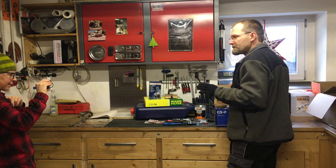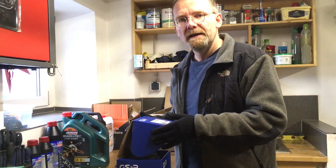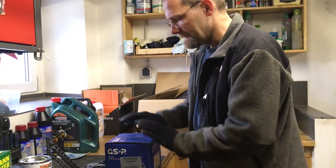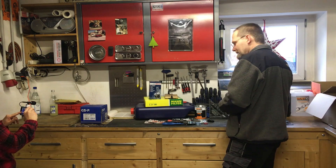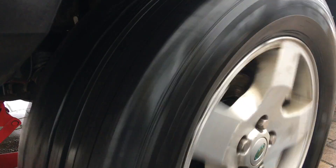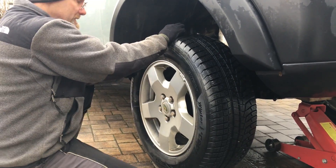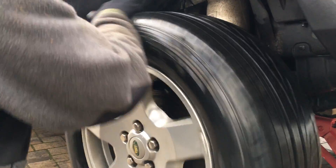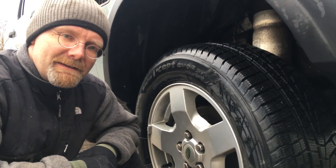This is the front wheel bearing — some people notice there is a lot of interior noise in our videos, and that's the wheel bearing, it's just very whiny. So we're going to have to do that today. Listen to how this one sounds... okay, let's go to the other side. Nothing — so I would say it's the one over there. But how could we be so wrong?